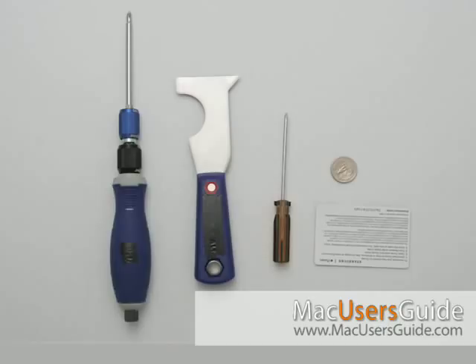These are some of the tools you'll need: a jeweler's Phillips number zero screwdriver, a Phillips number one screwdriver, a nylon probe or some sort of wooden dowel — a shish kebab skewer works really well — a soft cloth to lay down your Mac Mini on, a screw tray to keep things together, and a putty knife. It needs to be roughly 1.5 inch — 2 inch will work — and it needs to be a flexible blade, maybe one that is tapered. I should also include a quarter or a small coin, which works really well for prying the back of the housing off. I found that's the easiest way to get the Mac Mini to separate.